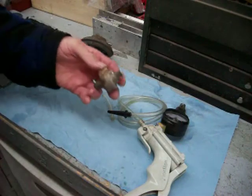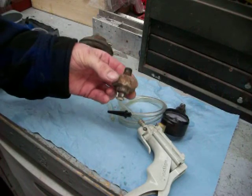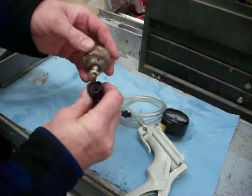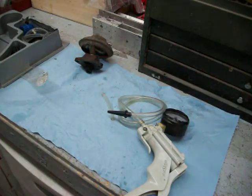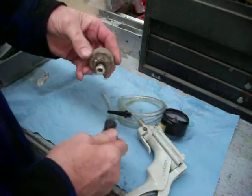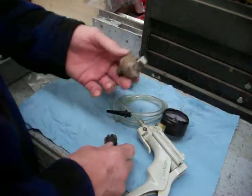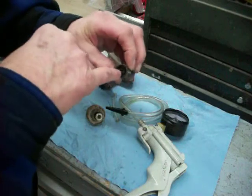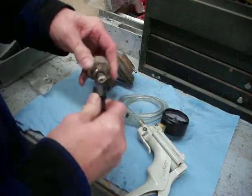The other thing was the knock sensor. The knock sensor is located in the side of the block on this truck — it's on the passenger side, right near the starter. It goes straight into the block and then this connector would hang onto that. For some reason the connector is not looking too good in there. When I went underneath to look at this, the connector was totally off. The connector looks a little bit melted there, and it won't stay on — it's got a very weak gripping thing to it.